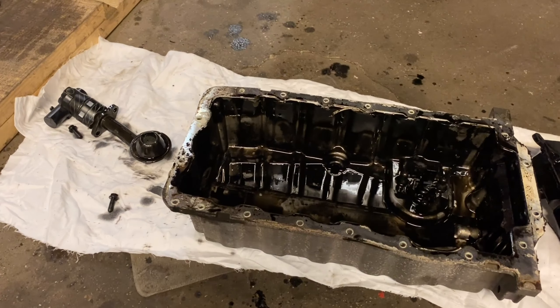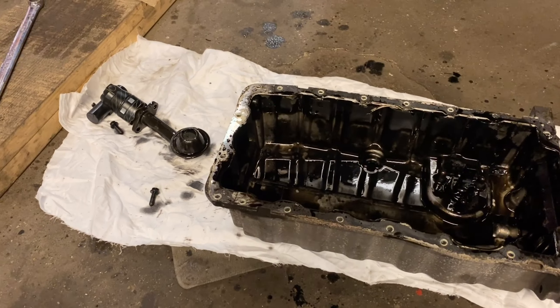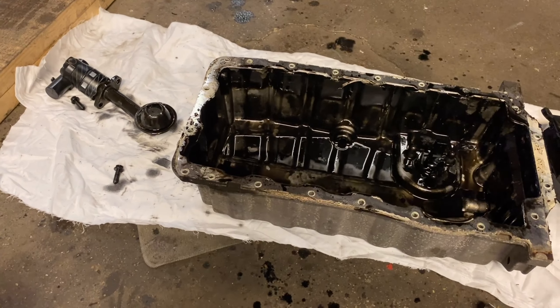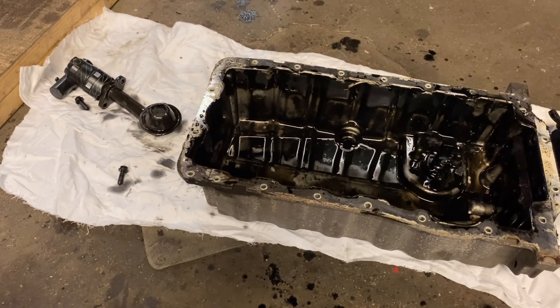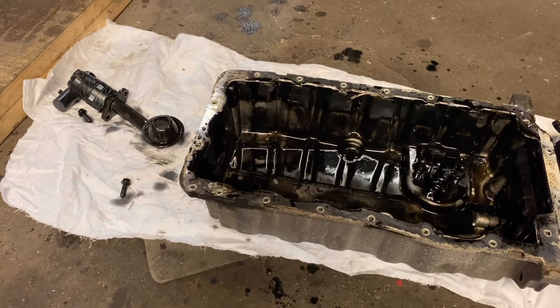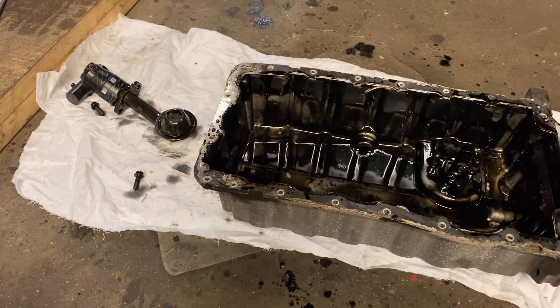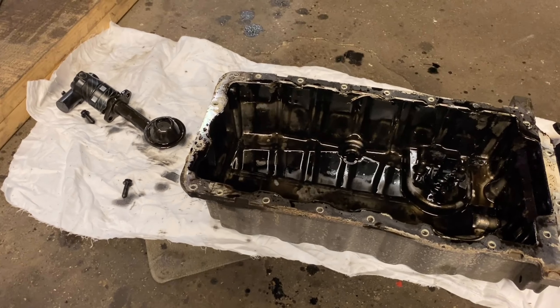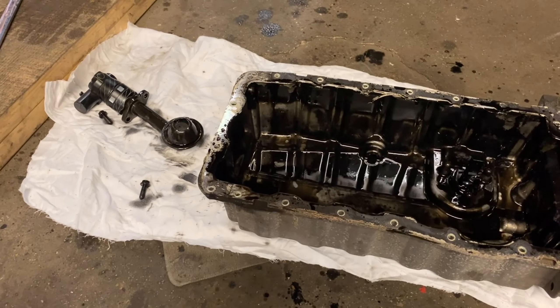There's a tiny bit starting to build up but it's not all choked up - maybe it's not just a common problem that happens to all of them. Going to clean this up, clean the pickup pipe, and stick it back on. I would never have known if I hadn't taken the sump off. This one's clean - regular oil filter changes. Do your oil and filter at least once a year or every 10,000 miles minimum, and you won't have any carbon build-up, no blocked pickup pipe, no blown turbo, no knackered engine. Any comments or questions, drop them below - I still reply to all of them. Click the thumbs up, don't forget to subscribe, see you in the next one.